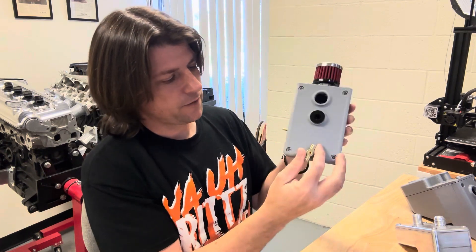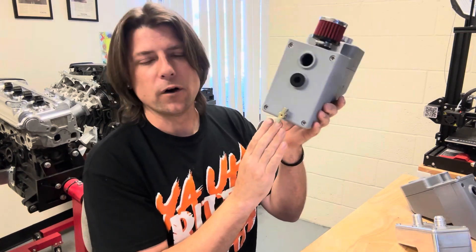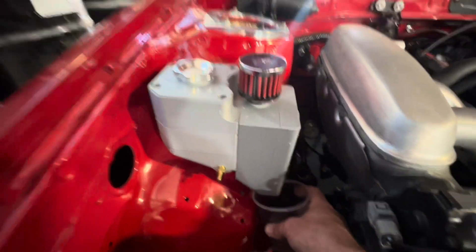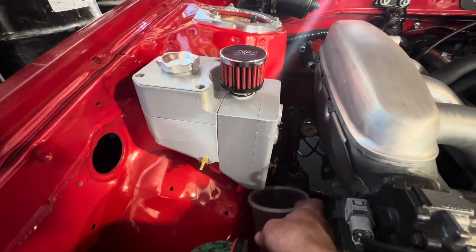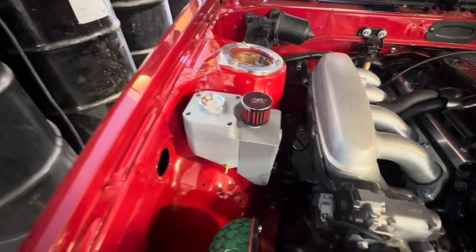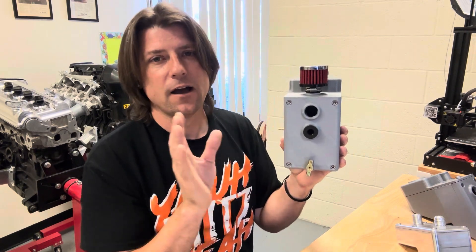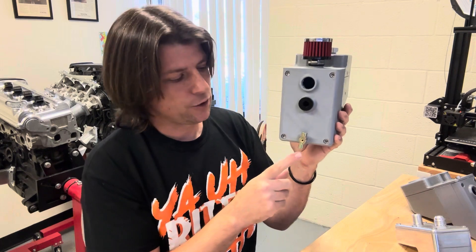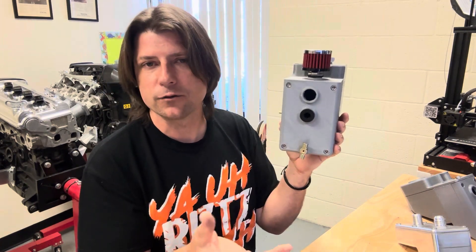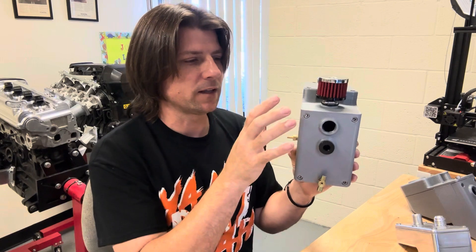You can see the drain fitting on the bottom here. Some people in the comments were saying I should put it on the bottom of the can. While that will help for getting all of the oil out, it's actually not as user friendly — when the can is mounted in the engine bay, it's very difficult to fit a cup underneath to catch the oil. The reason I'm putting the drain fitting on the right side is because next to the oil filter there's room to use a plastic cup to drain into. Also, this drain fitting could be replaced with a hose barb and rubber hose connected back to your oil pan using the eighth pipe fitting, making this a system that doesn't need to be drained — it would just continuously drain itself back into the engine while allowing fumes out the breather filter.